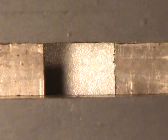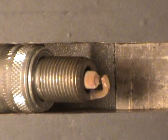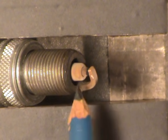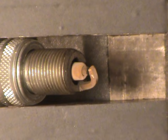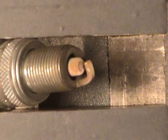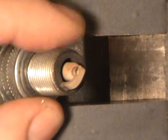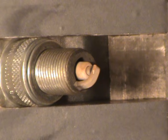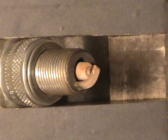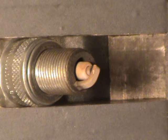Getting back to some of the readings — here's a plug that's a good example of kind of on the border. It's got that classic tan color, but you can see it's starting to head into almost a white ash color, kind of a grey. It's almost acceptable, you're starting to run a bit on the lean side. When you start heading into grey, especially with a carbureted vehicle, that's a sign to start watching out for things. If the car is not overheating and running well, it's something to watch. That grey color to me is a warning sign — I would probably re-jet the carburetor or start looking at a rebuild.